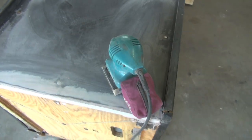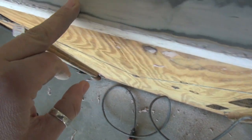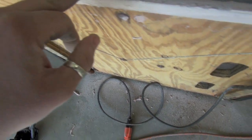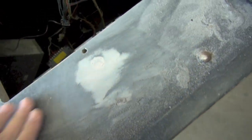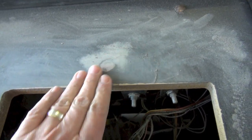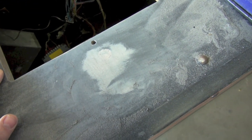We're done, and I think I did an okay job. The bottom needs a little more Bondo — it's better than it was but not as square as I want. I definitely used more Bondo than I needed. However, the holes back here are smooth as can be — that was a big success. Both holes are totally filled in. When I paint that, you'll never know there was a hole there. I just need to work on this corner some more.